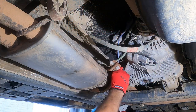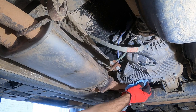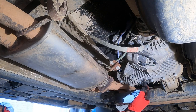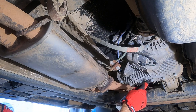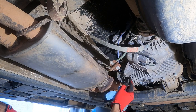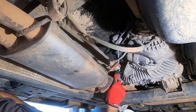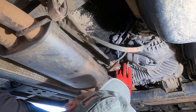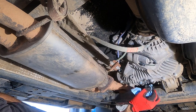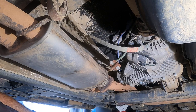So clean our faces as best we can. New rag. What we need to do is inspect the face here and the face on here to make sure that there is no damage. You should see a solid shiny circle where the copper washer has been sitting, and the same on this one. So let me have a quick look. Perfect. That's what we want to see. Remember, an engineer wants perfection and will accept excellence.